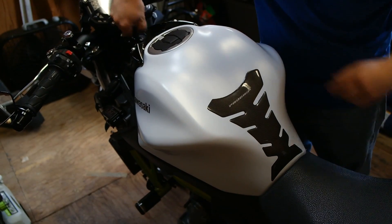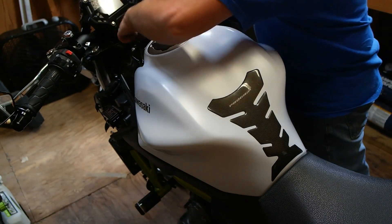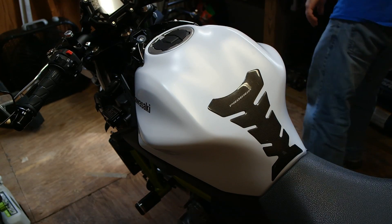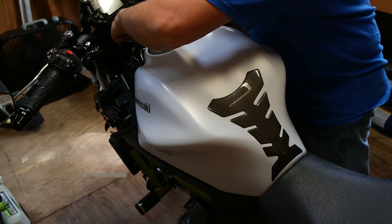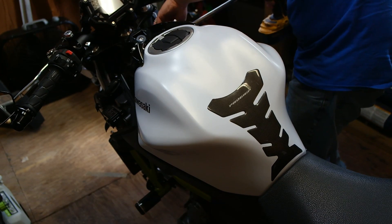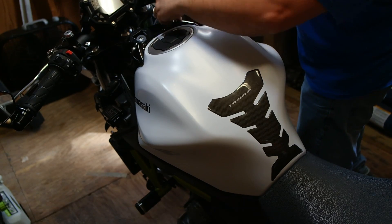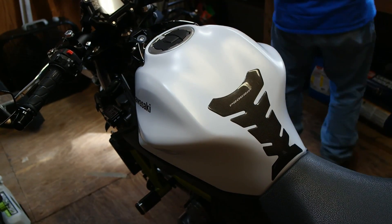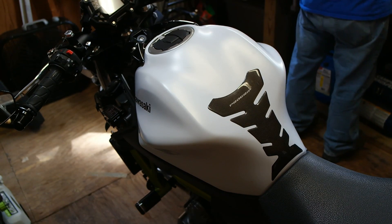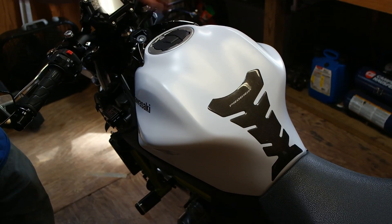This piece here you may be able to work loose — just pull right on it, grip with thumb and index finger, pull it right out. That's the trim ring for your key. You don't necessarily have to take that out, but I found last time that putting it back on, it wants to hit right here along the ignition cylinder. Now there is a plastic and a stainless washer behind the top too — a plastic washer that goes against the plastic piece and then the stainless next to the bolt.